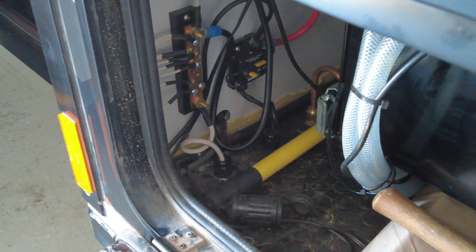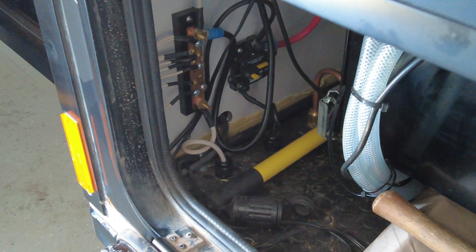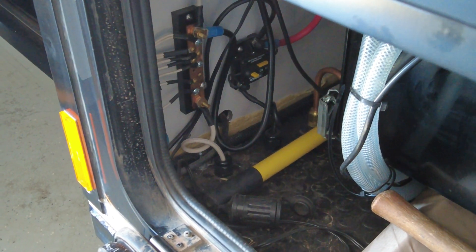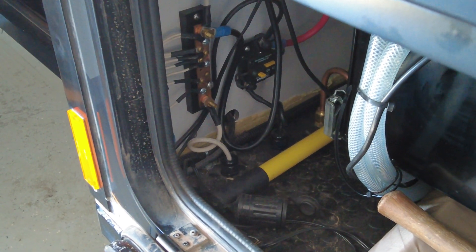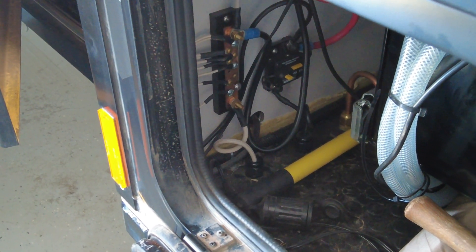What I did is I put it in there, put the nut in there, then I had to screw it with a wrench from the outside. Now looking at it from the middle — you can see in the middle there's two of those nuts, right there on the other side of that red wire. There's a nut on the side where the battery tray is, and there's a watertight seal nut on the side of the cab, so no water's going to get in. I've tested it — no water's getting through either of those. The hardest part of the whole thing is drilling that hole. I started small, got through the metal, went to the other side and broadened it on the far side, drilled all the way through the center, then widened it in the middle, and then ran the wire. I did have somebody help me run the wire — he's an electrician. His help was appreciated. I play with electricity, but I am not an electrician, so I used his help.